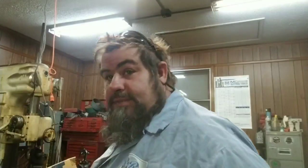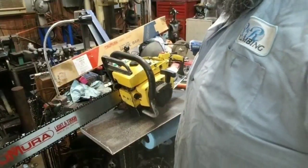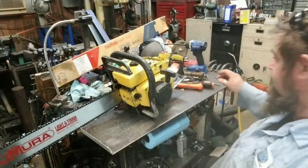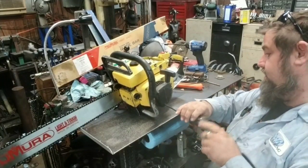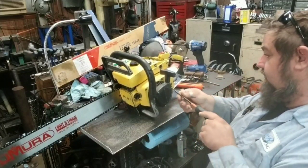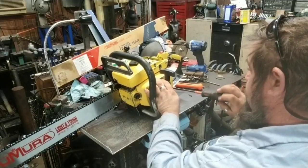I've been working on a bunch of stuff trying to get some things done. We're trying to film just a little bit right quick. I fired it up, got the bar and chain put on, got the other chain made. Fired it up this morning and the pull start wasn't wanting to get back in all the way — it's a little gummy. So I'm just pulling the side cover off, going to spray a little lube up in there and wind it up a little bit more.